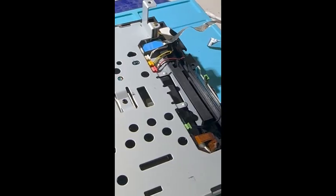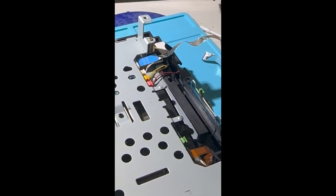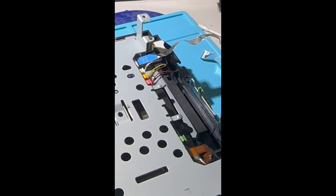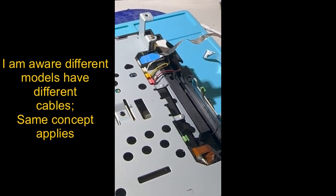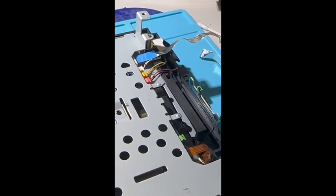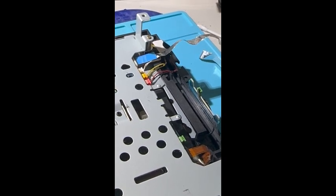Ta-da! If your PS2 has ever acted strangely, not necessarily broken, but emitting odd behavior, very commonly one of these cables can be either loose or completely undone. In particular, that top ribbon cable, which everyone knows is the most irritating cable as it is responsible for the power button. So during the reassembly, always make sure these are securely fastened before putting the screws back in.